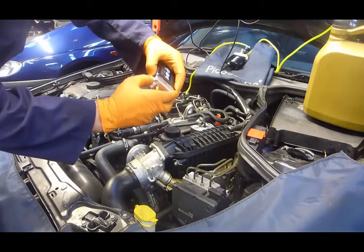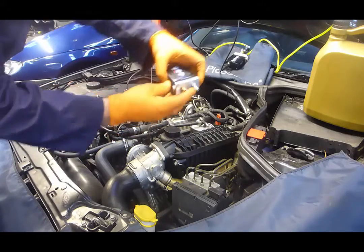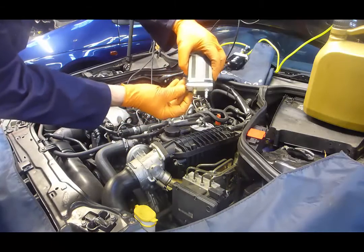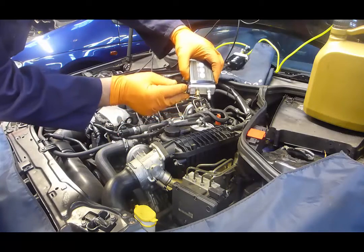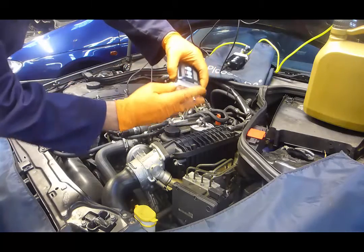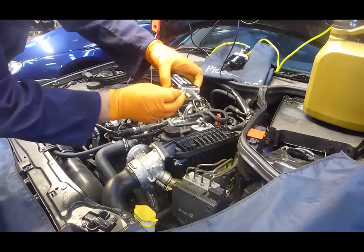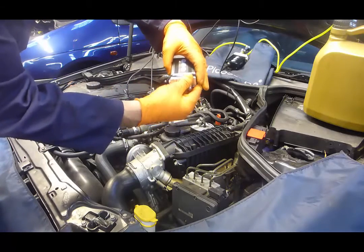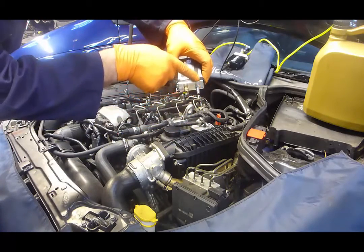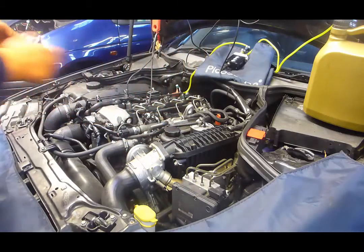How we do this is using a cable tie — that way we can actually keep the pressure tap, or the drain tap, or the bleed tap open when we're connecting this. The tap is closed... the tap is now open. So any pressure we apply here — back leakage — will drain straight through into our spill bottle.